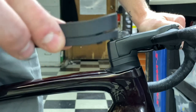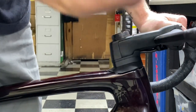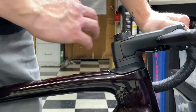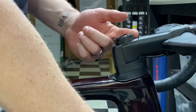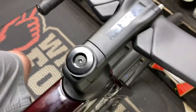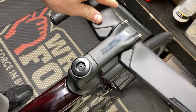And that's it — now we have it where we want to be. We lowered it and took off a good amount of stack and spacers. Do a couple of rides and see if your back and upper body can handle it. Once you decide you like it, take it to any Specialized dealer, have them cut it flush — and all you had to spend was a dollar or two on some spacers. Hopefully you guys found it helpful!